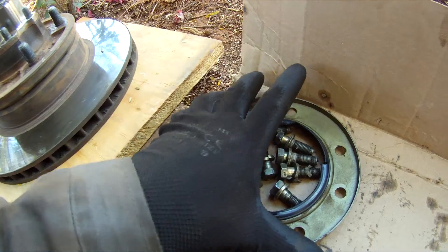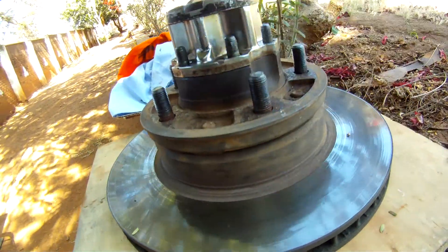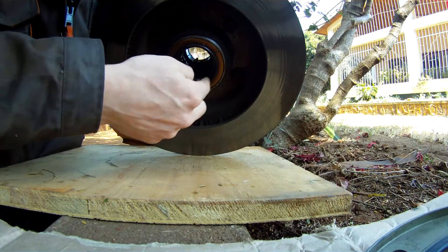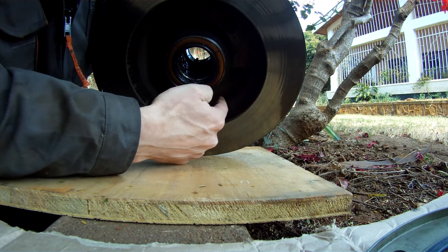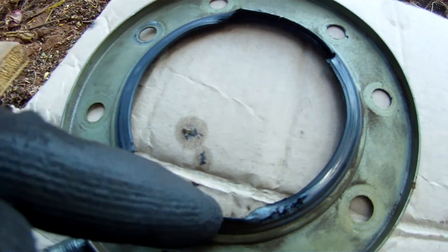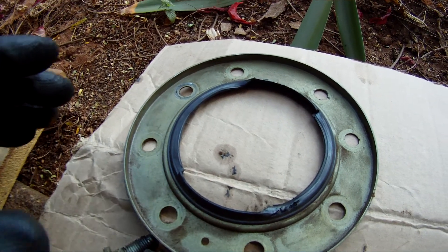This is the equivalent of Land Rover's mud shield. Land Rover just has a metal disc that runs on the inside of the hub with very fine tolerance to keep most of the mud out, and then the seal runs inside of that. Toyota have actually created a seal as part of this, so you've got the mud shield arrangement but then there's a seal that runs on the outer base of the hub as well as the normal seal that runs inside. I guess that's good because it doubles up the seals, but as we can see here, this one has been prone to not fitting properly and has been destroyed as the hub was put onto the stub axle — so plus one for being an extra seal, minus one for being easily damaged when it goes on.